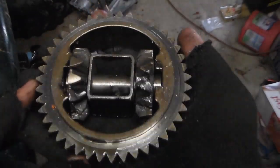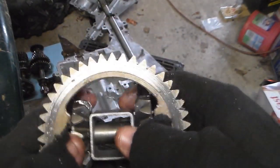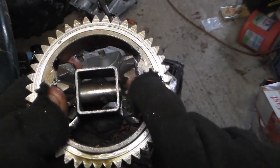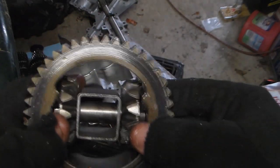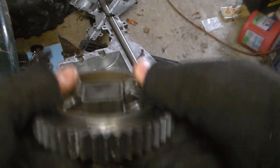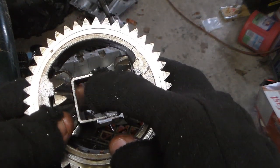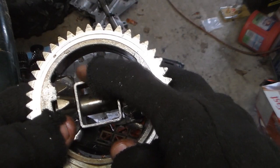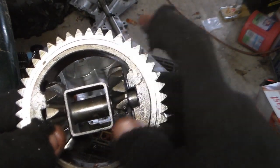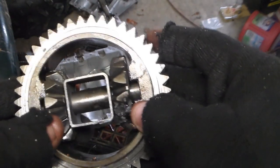As you can see, here is my newly redesigned locker block. So, once you take the one quarter inch and you drill the holes through, you can then put your pin through, put your gears on, line it up perfectly so it's at 90 degrees to the external gear. Then what I'm going to do is weld this internal edge, and then weld the gear itself directly on the top on either side, and from there I'll be able to drop it in, and we should be all set.